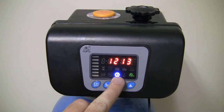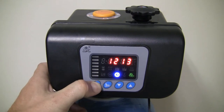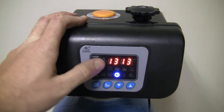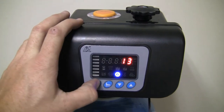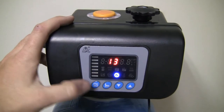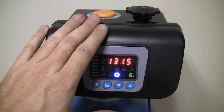The first thing that comes up is the time — you want to set this to the time of day, and this is set by minutes. I'm going to press up to change the 12 to 13, as it is a 24-hour clock and it's currently one o'clock in the afternoon. Then I press that button again to go to the minutes and press twice to go to 15. I press set again to confirm — the little spanner stops flashing, and now it's set to quarter past one.